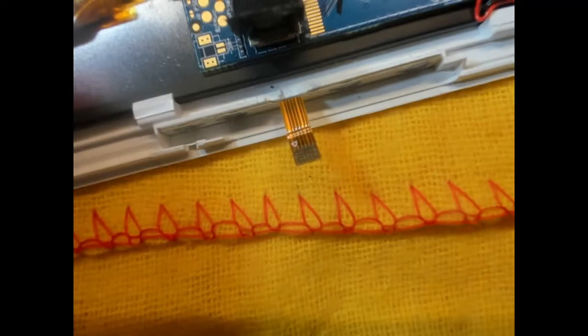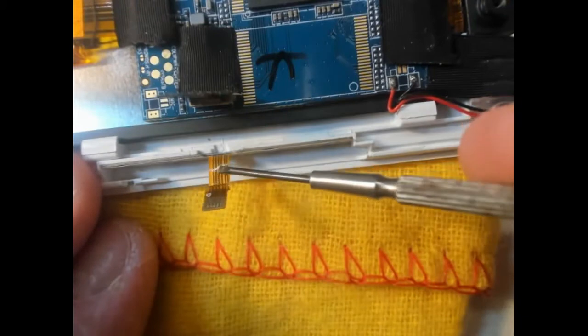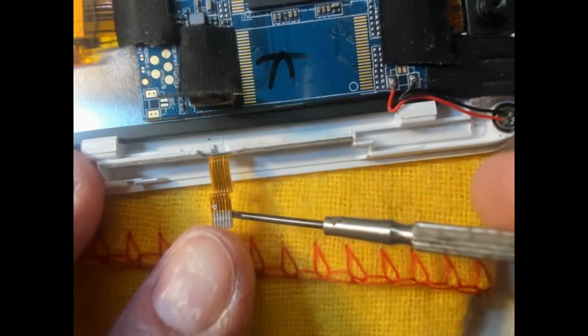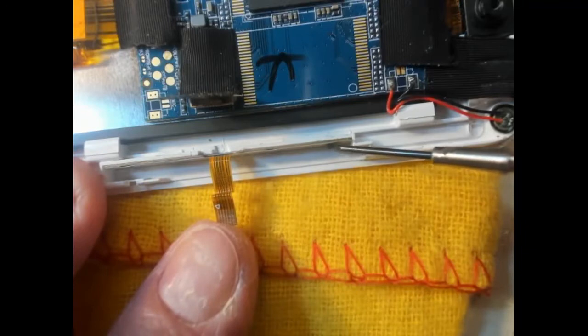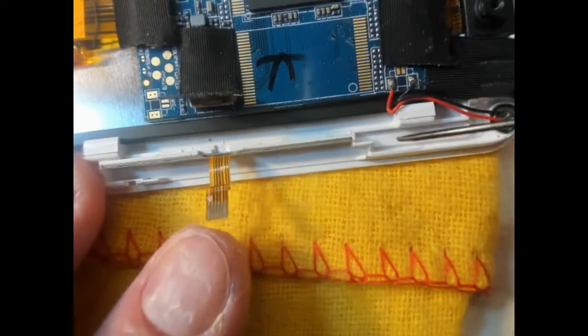Now it's going to be a bit awkward to do this on camera, so I'm going to see if I can just take it apart and see if it's the actual contacts of the switch which is just not working. Okay, so I've got really close up to these connections with my super magnifying glasses on, and I've gone through with that switch pressed in with the clip, that's been pressed in as though it was making contact, and none of these are shorting. So I'm guessing that this switch is somehow faulty.